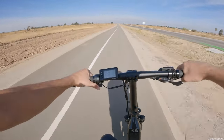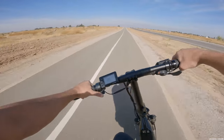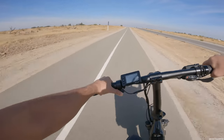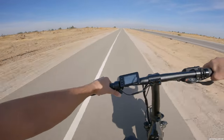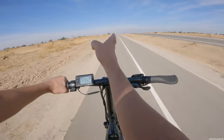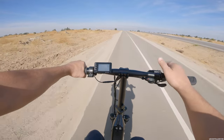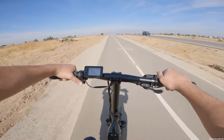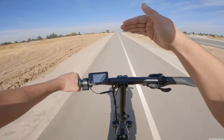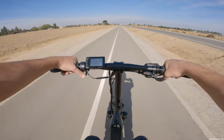On to the turning test. One thing to be careful about — if you're using a throttle, don't pedal while turning. As your speed drops in a turn at max class setting, the motor wants to maintain that top speed and will push you through the corner. I'm on assist level five and the power kind of came out of nowhere when I was turning, jolted me forward — it scared me, I thought I was going to go down.